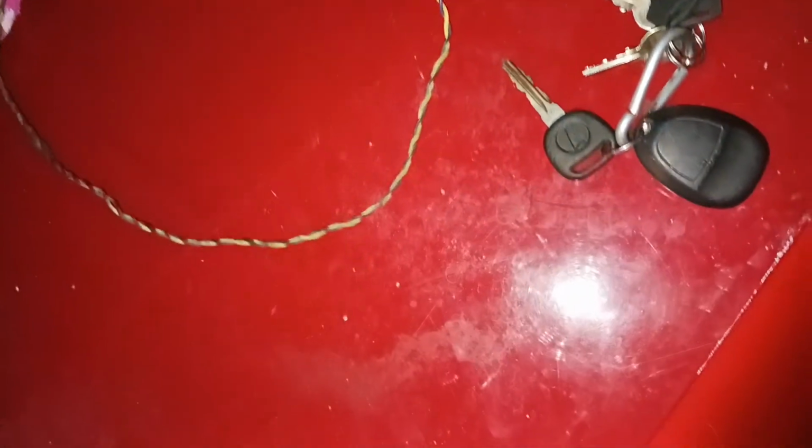And a lot of times this wire, see, like right there, it's a little bit frayed. If it'll float, there it goes. Yeah, it's a little frayed right there, so I have to tape that up. But I need to check and see if the wire is damaged on my mom's car. And if it's not, then I don't know, then it's probably just the sensor. But it could be the wiring, it could be the sensor. So this one was a known good working setup, even with that wire right there being a little melted. It doesn't look frayed, it just looks melted.